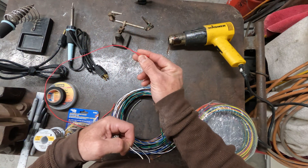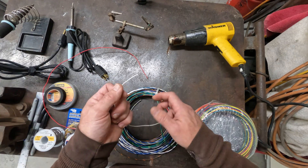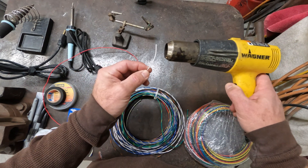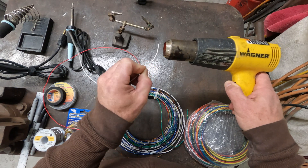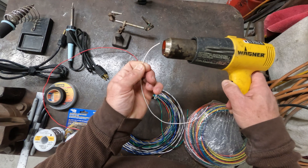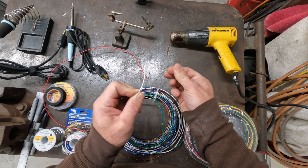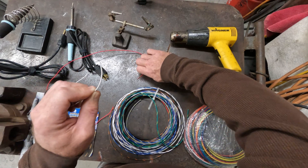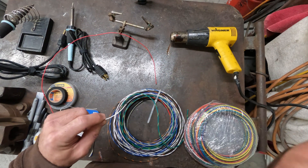That was just a one-time heating — of course a heat gun applies way more heat than normal — but over a period of time, riding in summer or cold in winter, when this is in your wire loom with all wires crunched together and taped up tight, the heat will start to deform it, break through the insulation, and it will crack over time. Now this is clipping of the GXL/TXL series wire — we'll run the heat gun on that. You'll notice it does not expand at all; the temperature is not affecting it.